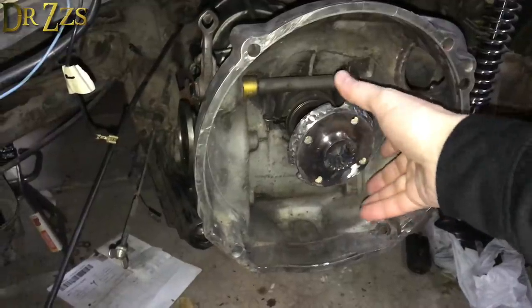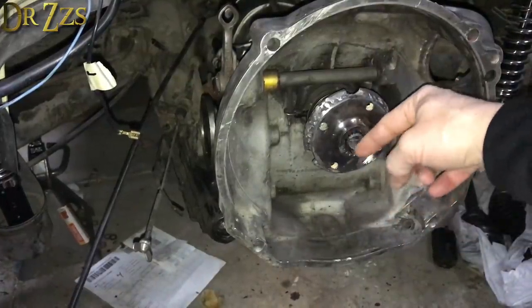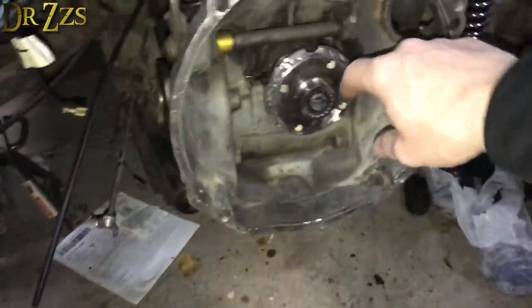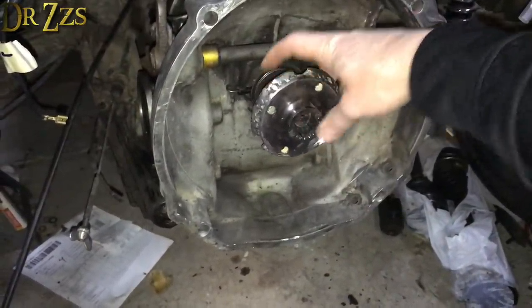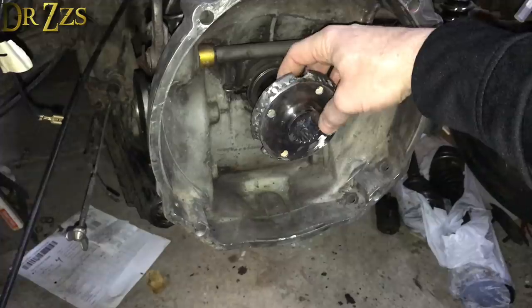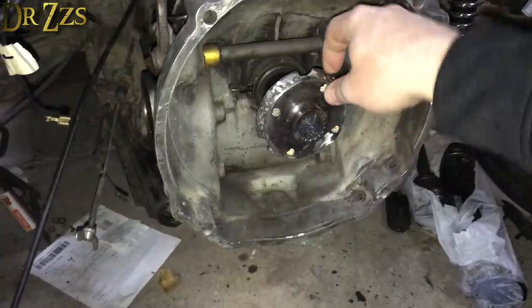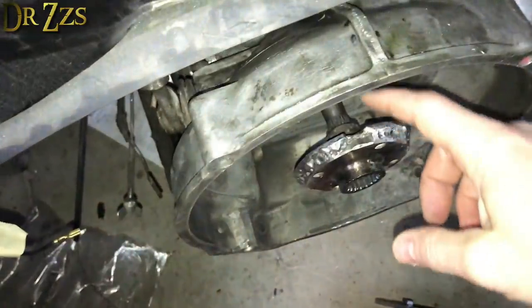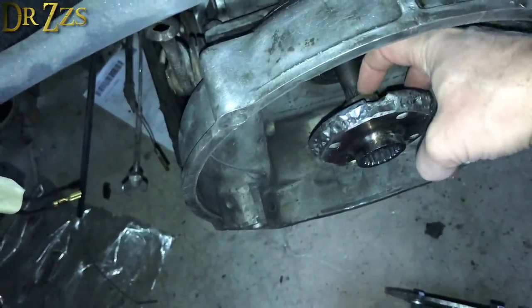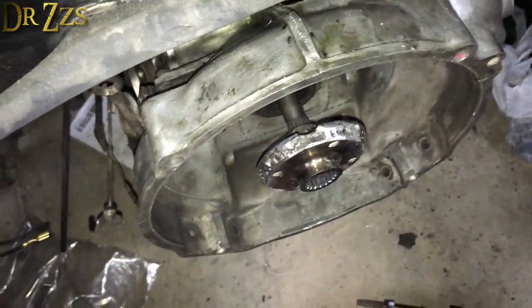So this is what I'm talking about. If I just push this, it'll slide all the way on there until this shaft is coming out, and that'll be too far for the motor gear to fit. So I'm going to pull it back a little ways, somewhere in there, so I still get maximum transmission shaft engagement with the gear inside, and then put just some spot welds back here, not to hold this on, just to give it some bumps so that it can't slide back any farther. Hopefully that'll work.